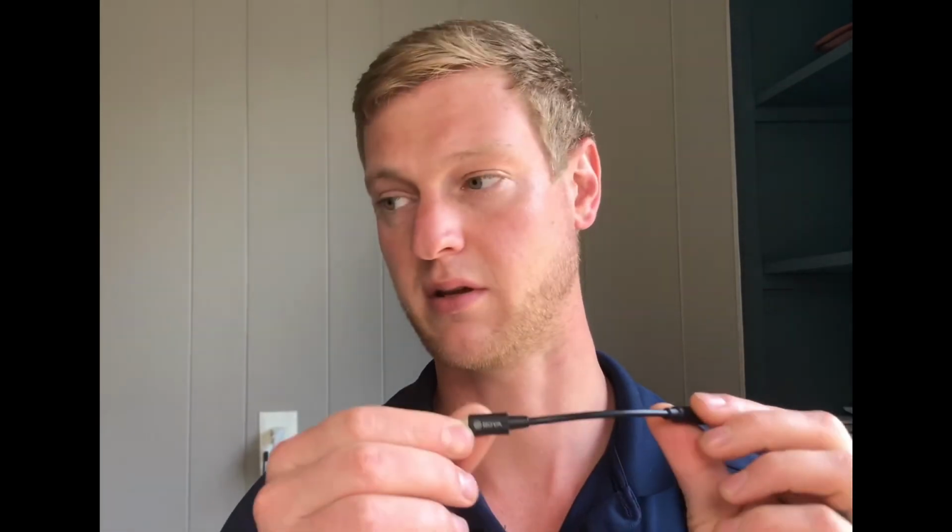And then you get this monitor one. It doesn't monitor live. I kind of wished that it would. You have to record the video, then plug your headphones in, then you can hear it. But yeah, that's what I'm using there. And then this is the one that I use, and these are everywhere. You just want to make sure that you don't get a TRS on this end. It has to be TRRS. This is the Boya BY-K3 is what I'm using. So that's my setup.